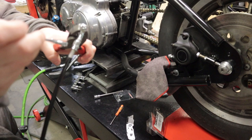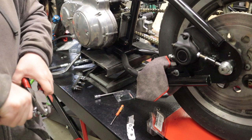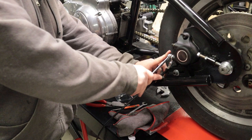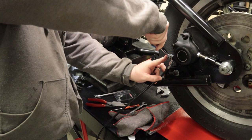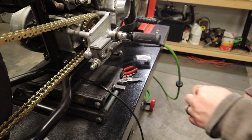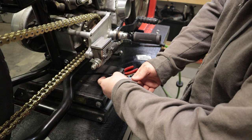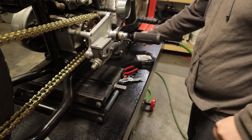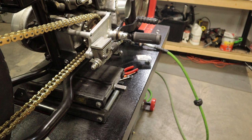I like to hold the end with pliers while I tighten this nut. Now that it's assembled good and tight we can go ahead and install this on our caliper. The brake line is run under the bike and I have some temporary zip ties in place just to hold it where I want it. Now we're going to mark it, get that cut, and it's just going to be the same process again of removing that sheathing and installing the piece.